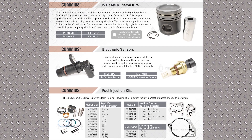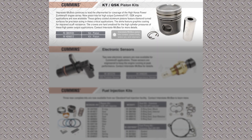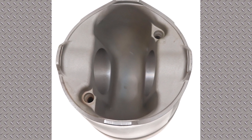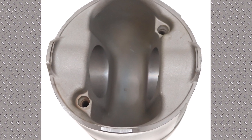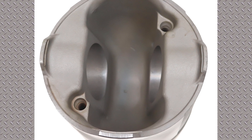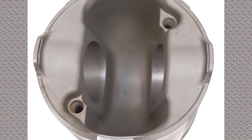Next is some gallery-cooled pistons for the Q and KT series engines. You can see here the cooling galleries where the cooling oil is injected into the piston and then circulates behind the ring pack to help cool the ring pack so the rings don't stick.